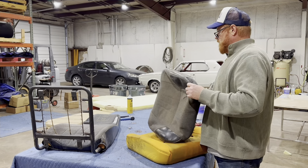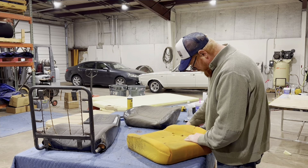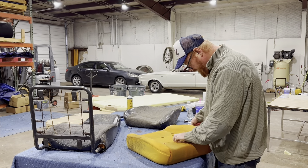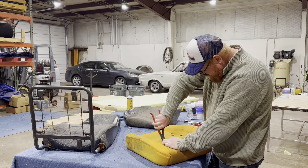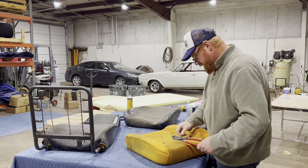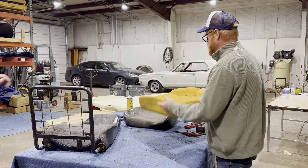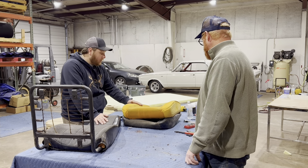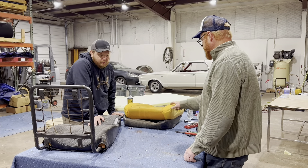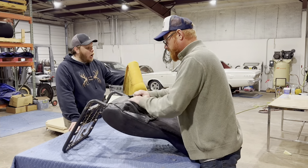Now I'm just going to trim them back the way they're supposed to go. These seat covers were dusty. I'm grabbing the hog rings out before I forget, because they'll tear up the new seat if I don't — you always want to get them out right after you cut them. Sometimes they get deep into the foam. Now I'm looking at the foam — these look pretty good. There's a little spot that's a little soft. Ethan came over and gave me some advice, saying he thinks it's okay.